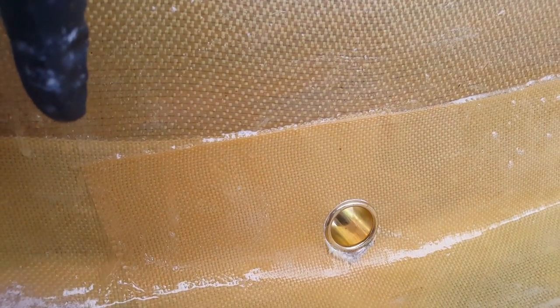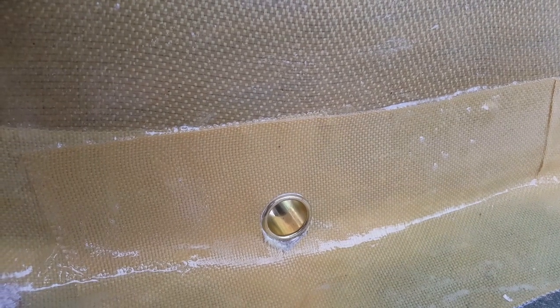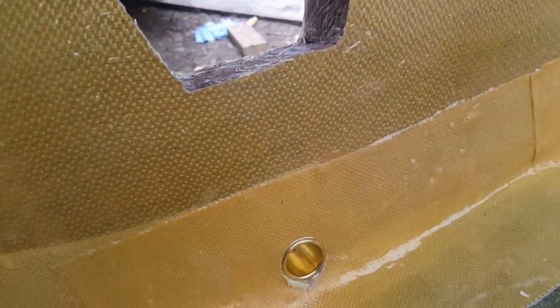That's a drain plug install — nothing crazy. Just remember: when you measure on the other side, leave anywhere between an eighth to three-sixteenths, and definitely bevel the bottom side otherwise your drain won't sit properly. I hope the video is helpful. Click on that picture of me riding in the boat to subscribe to the channel. Leave comments, like the video if it was helpful, and we'll catch you on the next episode.